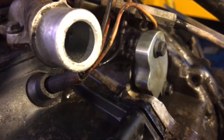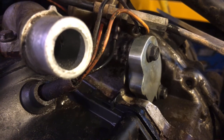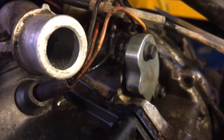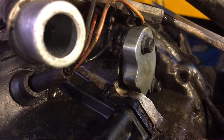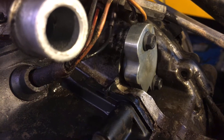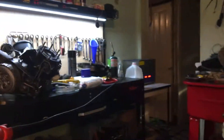Press that little block-off in there — it comes with an o-ring already on it, you just pop it in there. Finger tighten your bolts and then snug them up with a little ratchet. Pretty simple. Remove your oil injection and you mix your own gas.